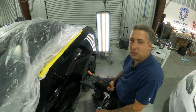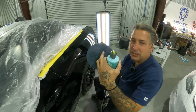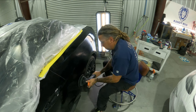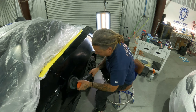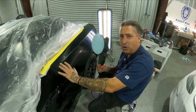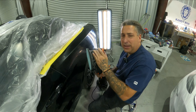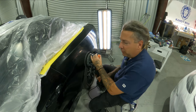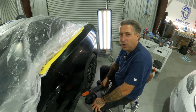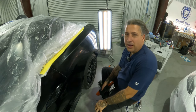When you're putting it on a fresh pad, make sure you lube the pad up well because this is an aggressive pad even though it's a random orbital. What I really like about using this pad is you get real finesse on the orange peel, especially with the random orbital. With the thinner pad you have a lot of control — you can really work it out — and at the end it duplicates the factory orange peel with that perfect look.